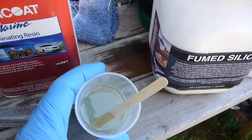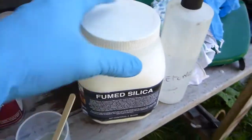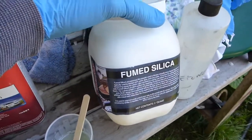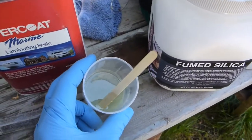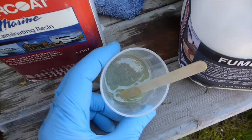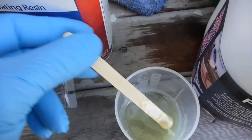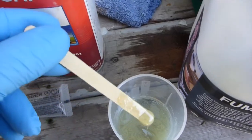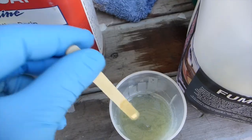To patch up this hole I'm going to use a combination of resin and fumed silica. Fumed silica — this is a very light jar, a couple quarts and it weighs just a couple ounces. It's basically little glass beads of fiberglass, and you don't want to breathe that stuff. Mixed into fiberglass resin it gives me a paste. Depending on how thick I make it, I want it thick enough to drain down into the hole but not drain out completely.